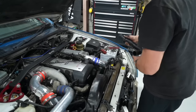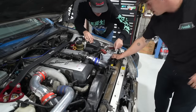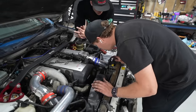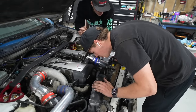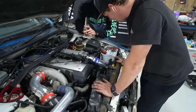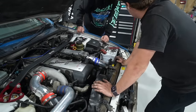I knew it was bad, but I didn't realize it was that bad. Oh, it's so bad. Oh, man. It should be radiating that out at the same time. So take these 10 mils out and it should come out. Yeah, no, I guess you're right. Undo your bottom hose. Just make sure you don't miss that sensor down there. Yeah, I see that. What a lot of us do too is we connect those two wires together and the fans will constantly be on. Oh, I definitely want to do that.